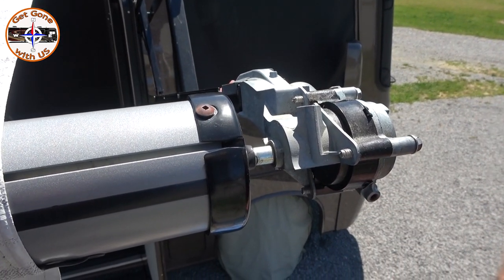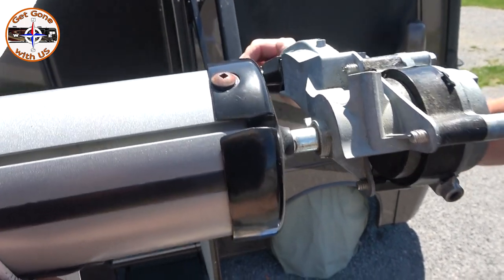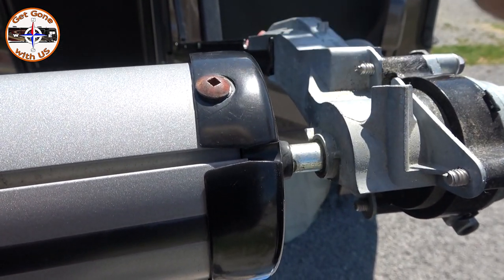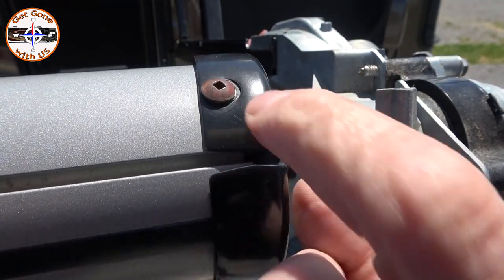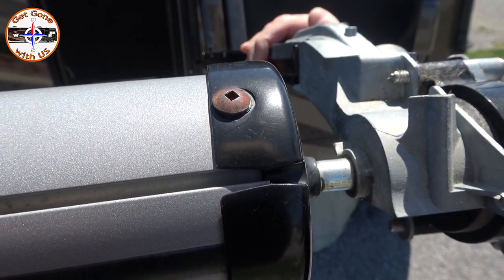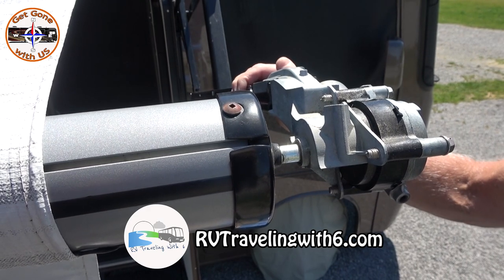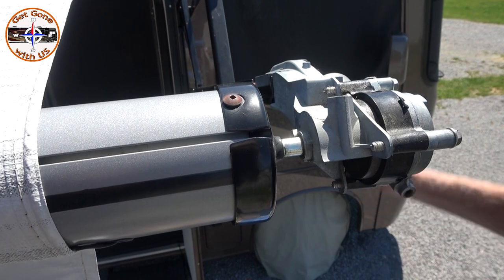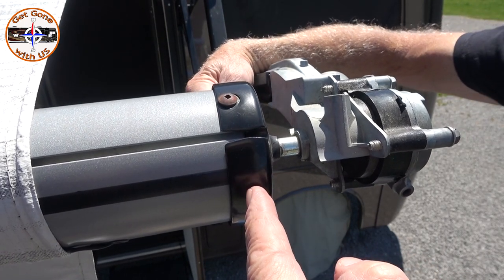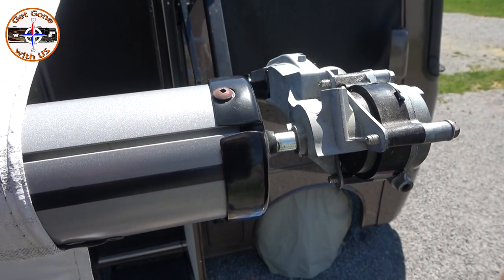What we found out after we did all of this the first time was the problem lies right here — look at the arm. What the motor does is it spins its arm right here into this cap, which turns the awning in or out. There's a cap on the other side too, but check out the screw — you can tell it's been wearing. So the first time I just tightened them and it worked fine, but then it started getting loose again. I was talking with my friend Brandon from RV Traveling with Six, and he told me he ended up just throwing in a couple of extra screws. That's a lot of power for just two screws. So we're going to put in two more — one at 12 o'clock, three o'clock, six o'clock, and nine o'clock, or thereabouts. We'll do this side and the other side too, to put an end to the arm wobble.